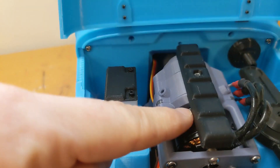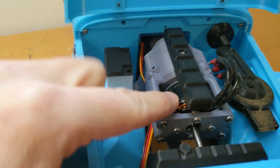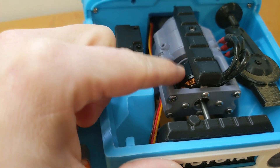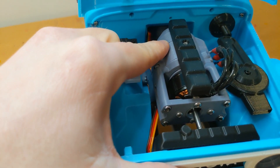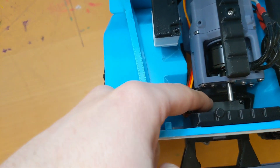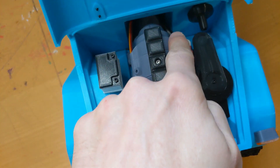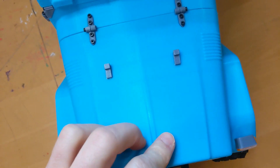It is driven by a brushless outrunner — I think it's a C3530 motor, 1100 kV — and the gearbox here is a belt driven gearbox so there's four different belts inside there. The servo is right underneath here for steering. All the wires run through here and they run through that center console in the cab and into the back, and that's where the battery is.